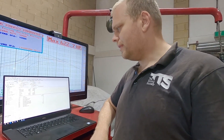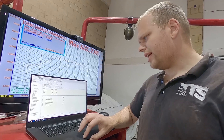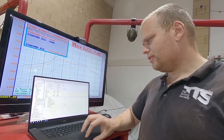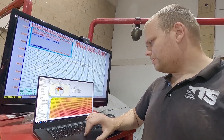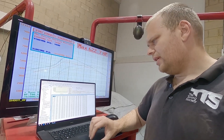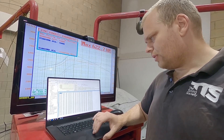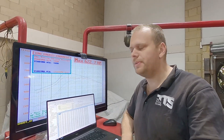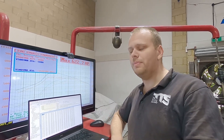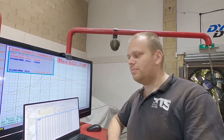We've done all our work in EFI Live. The main thing we had to do was build a volumetric efficiency fuel map. In EFI Live under Airflow, they don't have a VE table as such — they have a virtual VE table — so we had to build the surface and then generate the coefficients which create that surface. I've already mentioned the injector tricks we had to do. We also tuned the spark table. Torque control required a bit of work — there are a few limiters in here and the torque limiters expect a car making around 400 foot-pounds. Initially when you add boost, the car accepts it and then retards timing by 20 degrees trying to keep torque down to factory levels. So some work in the torque model was needed. But other than that, using a factory ECU and EFI Live, we managed to complete the project — the car fuels properly and boosts properly.